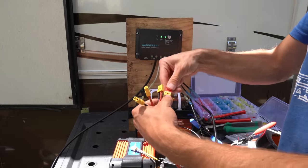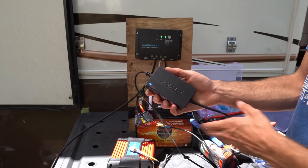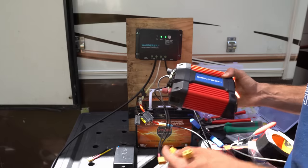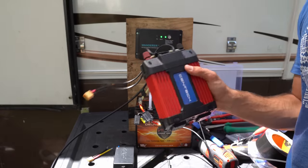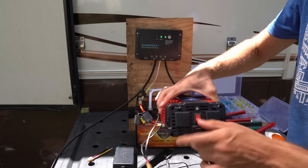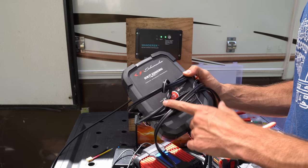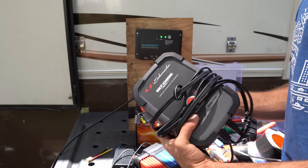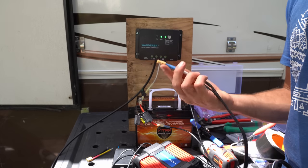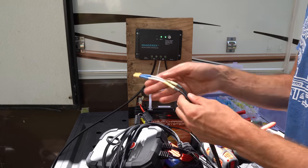Because this is all connected we can plug it in. You will see the light illuminate and now you can connect this to your laptop. Depending on the size of the inverter you can connect it to this as well — I'm only going to be powering small things so it's safe. But if your fuse blows you're going to have to connect it directly to the battery with its own supplied cables. This is our AC outlet plug charger — you can use the clamps that come with it to attach directly to the battery, or for a more permanent solution you can use an XT60 connector with an adapter or splice a terminal connector directly to the battery.